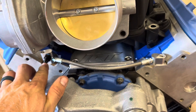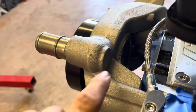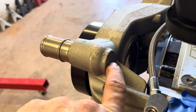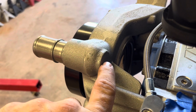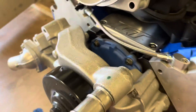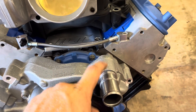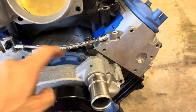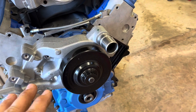The ICT billet crossover puts it on the passenger side versus the factory which has it on the driver's side. I've got a 1/8 NPT straight fitting here which is a dash 4. We're going to drill and tap into the water pump right here — that's our return — and put a 90-degree 1/8 NPT fitting in. Then we'll build a dash 4 hose so it goes back to the radiator where it can burp.